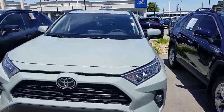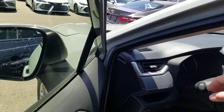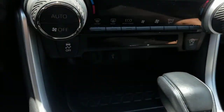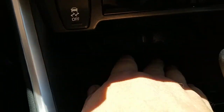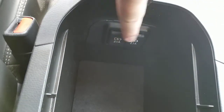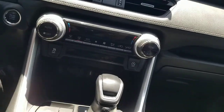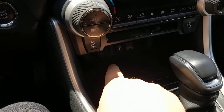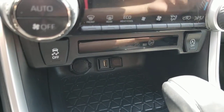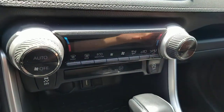I'm going to pop out to a new model RAV4. Now, some of the older ones might not have CarPlay or certain features, but what you'll find is the exact same thing. When you pop down here, you've got a USB that is below your radio. USBs inside the console could be different — the Camry had a USB-C style, this one does not. So if you try to plug in on the inside of your RAV, it won't work. Try to plug in down here and it will. A 2019 RAV4 doesn't have Android Auto but it does have Apple CarPlay, so plugging in hoping to get Android Auto won't work on a 2019 RAV4, but it would definitely work on a 2020 and above.